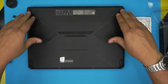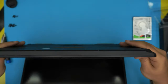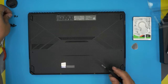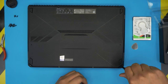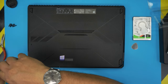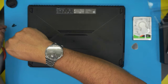To reassemble, align the top cover and push it down — make sure you hear the clicks. Then open the lid and pinch the top and bottom covers together all around, including the back end, pressing firmly until everything closes. Finally, put the screws back in: short ones in the middle toward the front, long ones on the sides toward the back. I hope this video helped you replace or upgrade your hard drive on the ASUS FX505D!